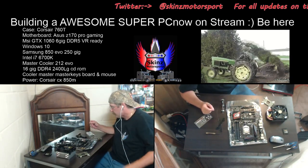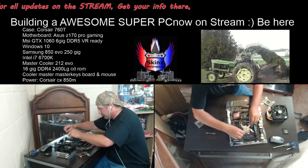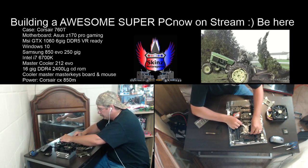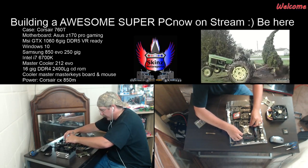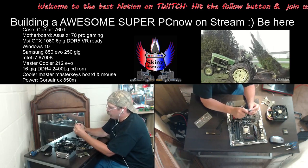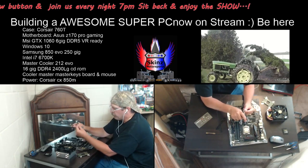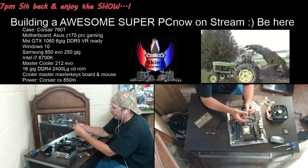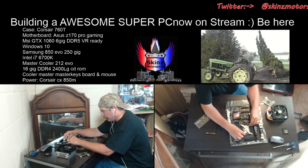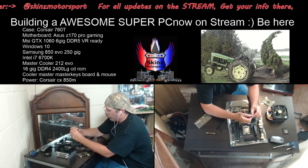Now, what we want to do is match up our legs to the holes on the board, making sure that the cooler goes in the right direction, which I believe is right. This one we have to move to the middle, and this one to the middle. So if you push up on this spring, there's 3 different slots here, and you can move it to a different slot. So now we're going to test again, and I guess we're going to have to move all 3 of them. You can either push up or pull from the top of the screw.